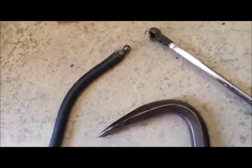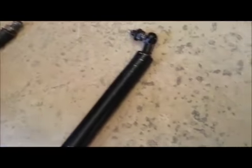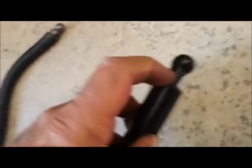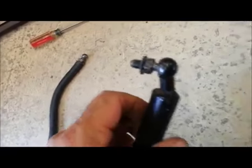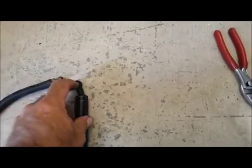Because there's that circlip, you'd think you could just use a crowbar and pop it out. Here's the result on the other side — I clamped this in the vise, put the crowbar around here, and as I pulled it dislodged and it's ready to break off. So I'm going back to plan A. I'm sure somebody might chime in and say there's an easy way to do it, but right now it's not working out for me. I'm going to put the hose on here and grind around here just like I did on the other side to remove it.